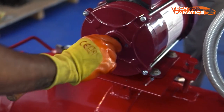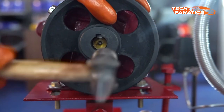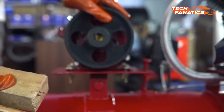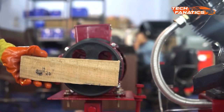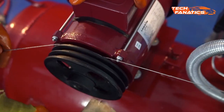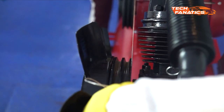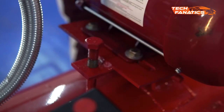Moving on, we'll now fix the pulley on the motor rotator. Align the pulley holes with the rotator in such a way that the hole shapes match. We'll use a hammer with a wooden block to completely fit the pulley on the motor. After the motor pulley is installed, we'll align it with the head pulley using a thread. We'll take a thread and while keeping it straight with the inner side of the motor pulley, we'll stretch it to the head pulley while making it straight with the inner side of the head pulley as well. If there is no bend in the thread, they're aligned.